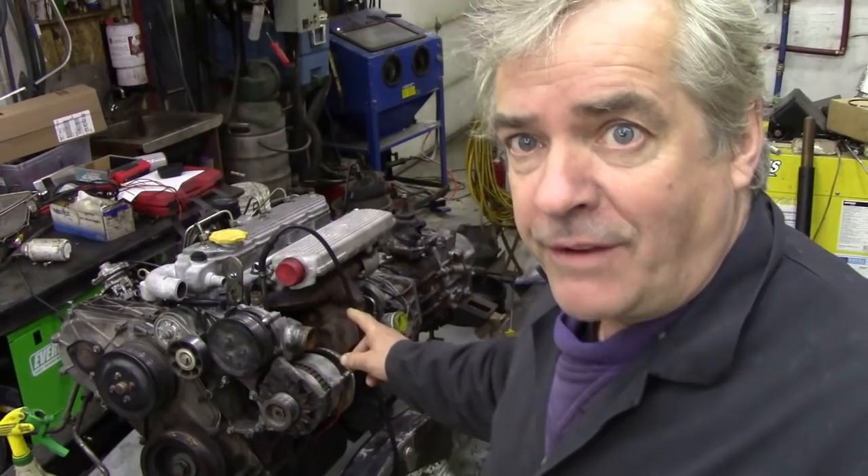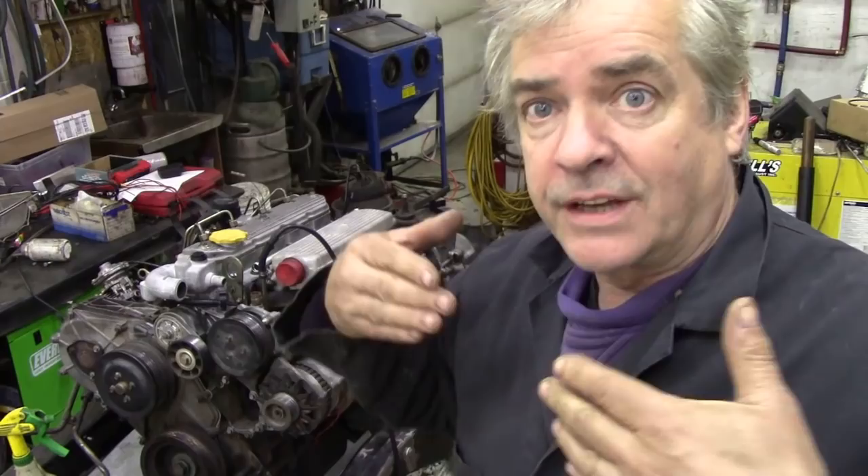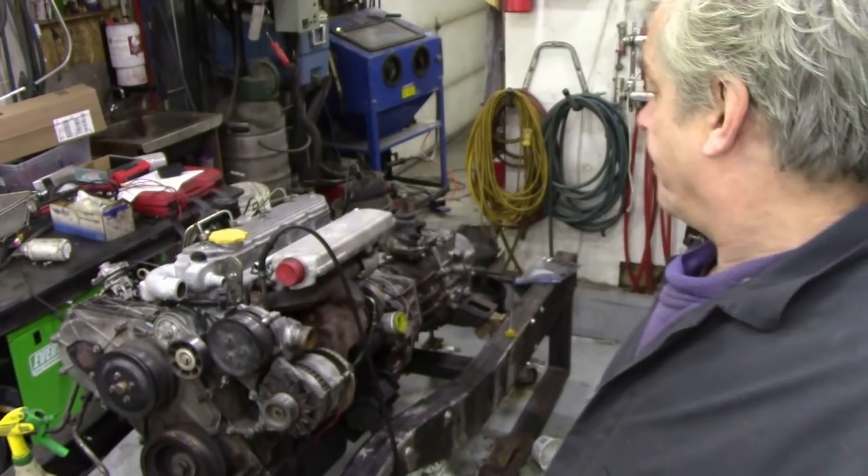I'm concentrating on the block itself. I've already got the manifold assembly, the exhaust and the intake. I usually put a plate across there to block out the air into the intake and exhaust ports. The reason for that is when we put smoke into this engine it will get everywhere — it's so thin it'll work its way through piston rings, fill the cylinders, and if there's a valve open it'll get into the intake or exhaust. This is to make sure the engine is oil tight before we put it in.